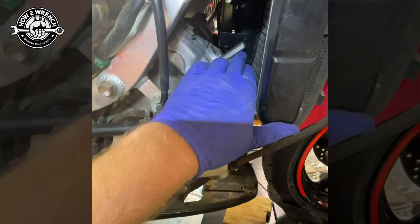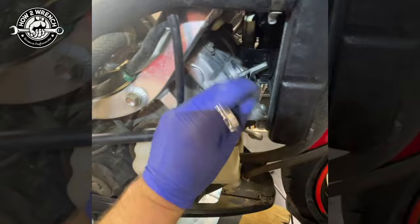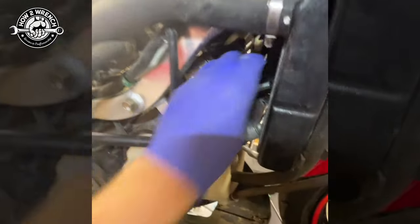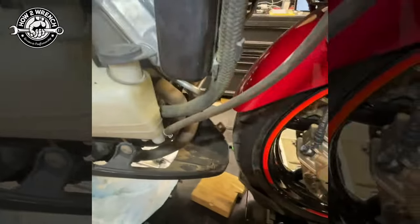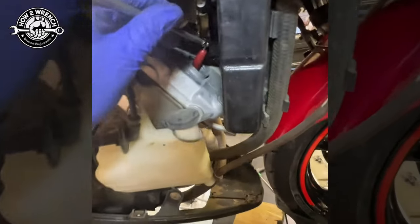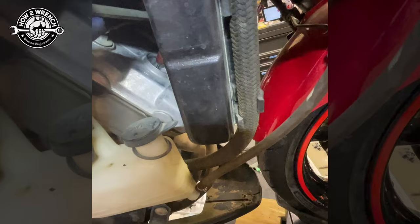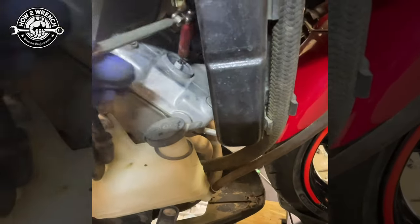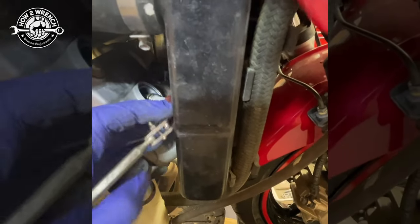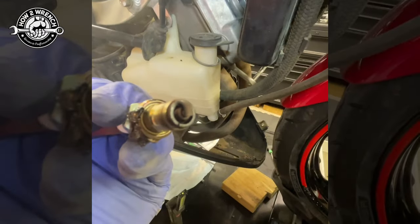You can slip that down in there — this will articulate — and then just take a 10-millimeter wrench. I could use a ratcheting wrench to ratchet that out of there. Then what you want to do is get yourself a magnet or a piece of hose or something. I find this magnet works pretty slick. You can see me one-handed getting that spark plug up and out of there to find out that yep, they needed changing.